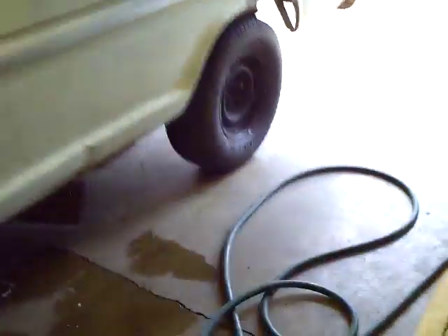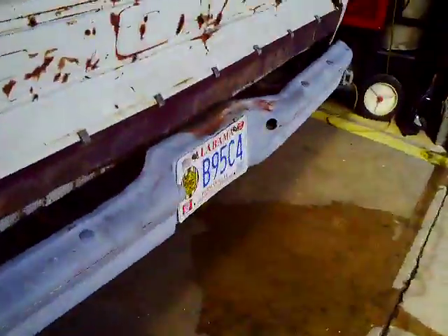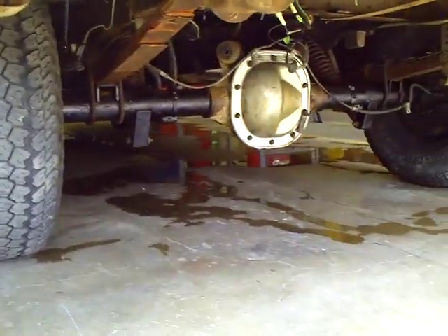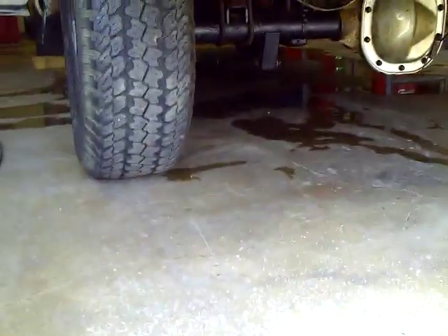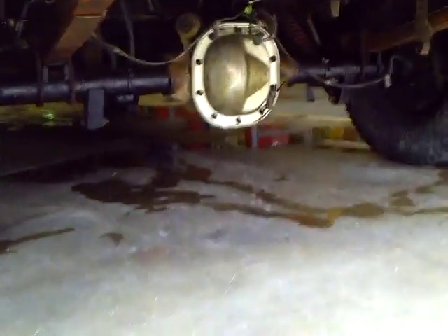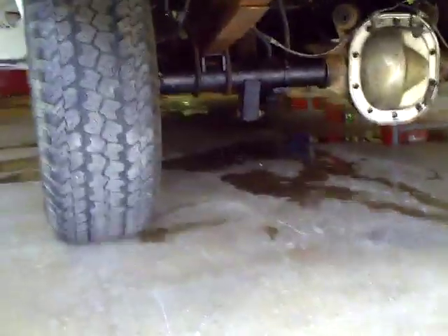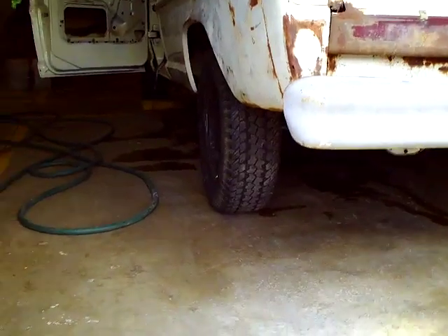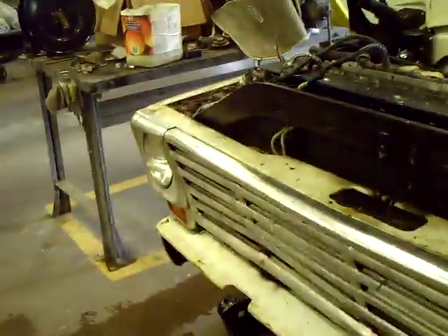The other major thing we got done was installing the 8.8 rear end. We had to buy some spring pads and have our welding shop weld them and the shock mounts in place, but all that's together now. As you can see, there are still a few little lines and wires hanging down — that's some of the little piddly stuff we're still going to have to fix. She's sitting about the way it should. The front and rear wheels look a lot more even now that we've swapped that rear end out and put in the 8.8. Because of this, we're going to have to have a drive shaft made. And the lights did go off by themselves — I think stuff like that's cool.